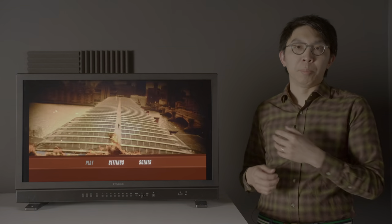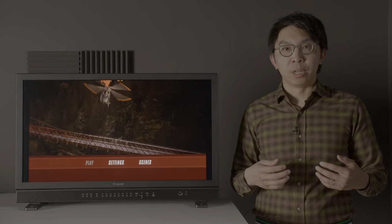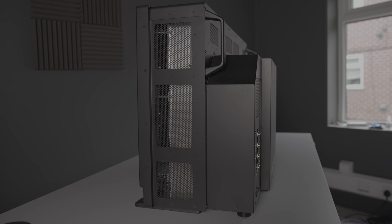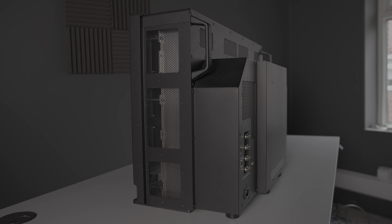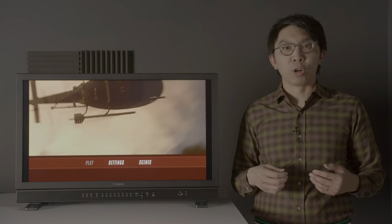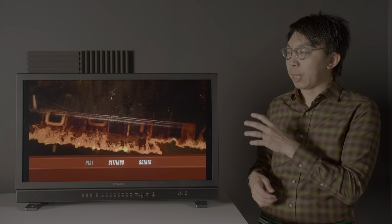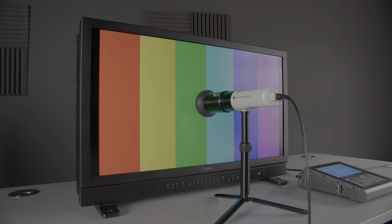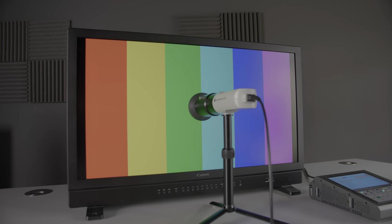The design won't win any beauty awards, but the target clientele won't care, because all other reference monitors in this price class look like this anyway, with thick bezels and an even thicker body to house the internal electronics and cooling fans. The Canon DPV3120 emitted a whirring fan noise upon power-up, but it's quieter than that generated by competing reference broadcast monitors of the same size, probably because the single-layer LCD requires less cooling than dual-layer LCDs. The front screen carries a matte finish, which rejects ambient light better than the semi-glossy finish found on some other reference monitors, at the expense of punchier-looking blacks.